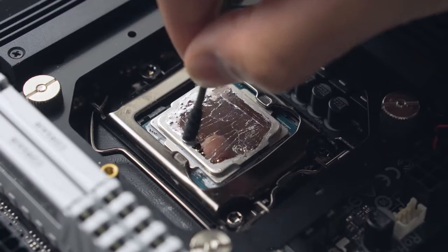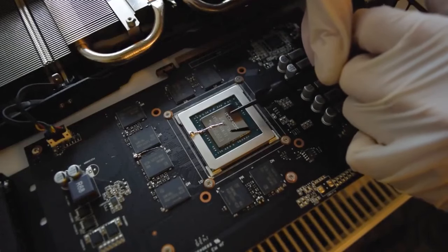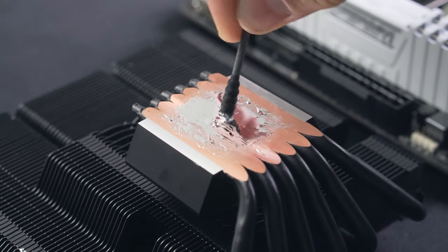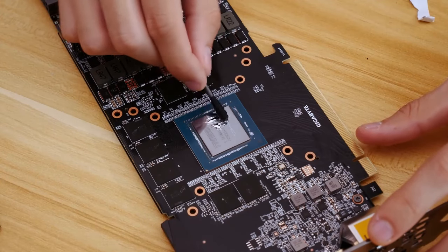And yes, forget about liquid metal. The T1000 not only conducts heat better than other thermal pastes, it also does it perfectly well with electricity, and even one unnoticed droplet on the board can kill it. On top of that, liquid metal destroys aluminum and copper, so it should be used only with nickel-plated heatsinks. So leave this aggressive substance to overclockers.